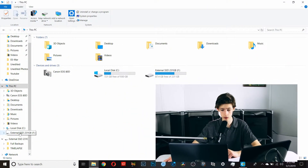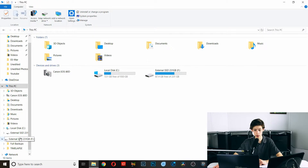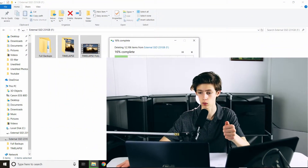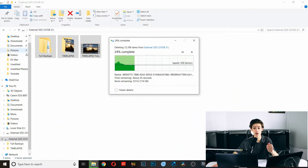The first step is backing up your data and making your recovery drive. For my recovery drive I'll be using an SD card. For backing up my data, I have an external SSD in a case that accepts USB, and I will be backing data up to that. I'm going to delete everything on it first since I had previously done a backup — there were 114 gigabytes. After this is done, I will show you how to do a complete backup of your computer to a drive.